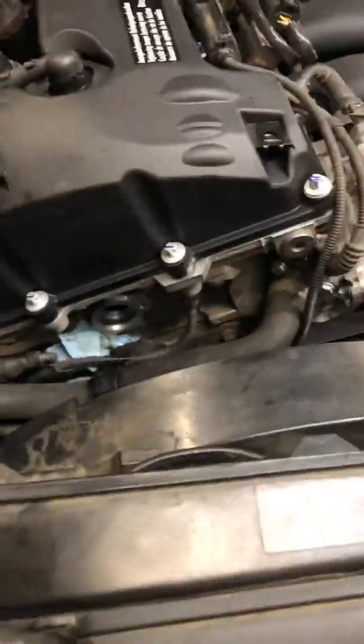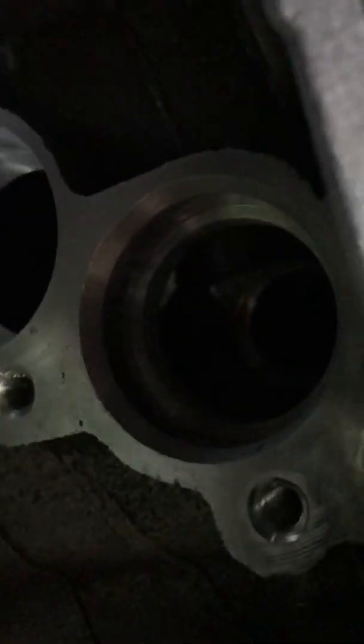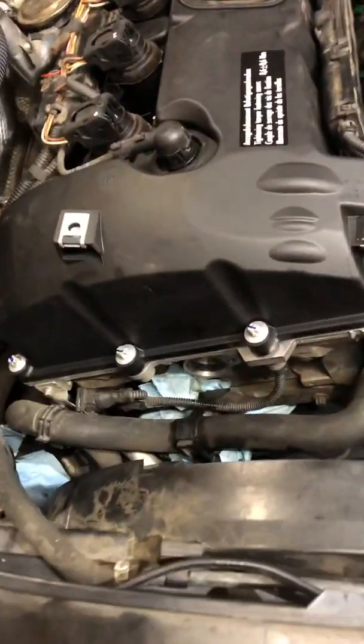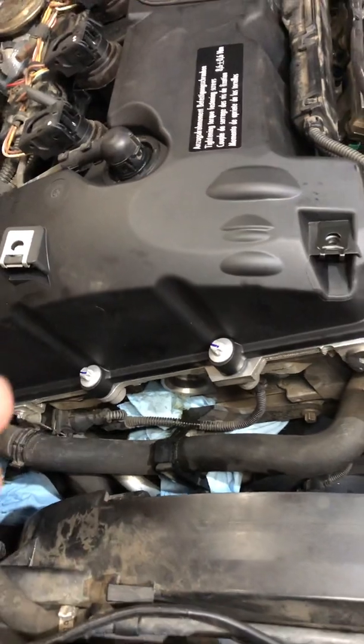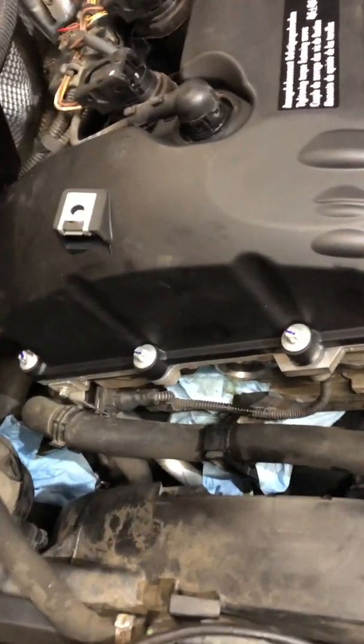This video is about the VANOS solenoids — we took them out. I'm not sponsored or anything, just doing this with my iPhone trying to help you guys out. Clean these out real good — the holes, the chamfer — and then lubricate the chamfer as well as the o-rings going back in, and you'll have a much easier time. Put some rags in there so any oil that comes out doesn't get on your belt and you're not having a major cleanup mission when you're done.